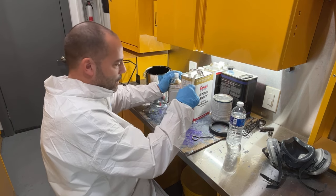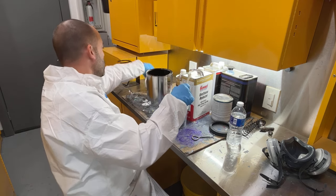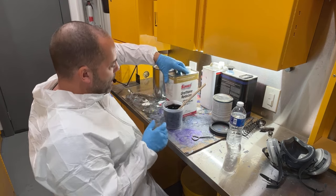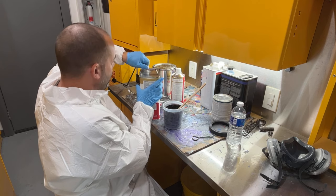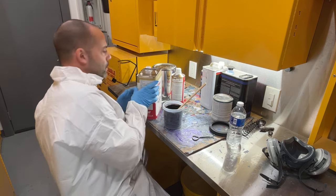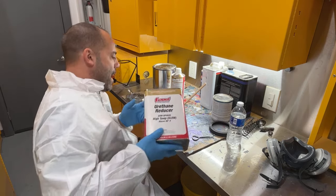It is not currently raining today. It is supposed to, we have a slight chance of rain tomorrow. So I want to get these parts in here painted. I'm going to bake them at probably 130 to 140 degrees for about 20 to 30 minutes. And then I'm going to let them sit for about 2 hours and just let the booth slowly cool back down, and then I'll be able to take them out of there